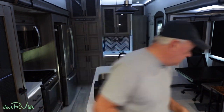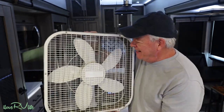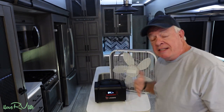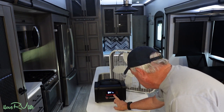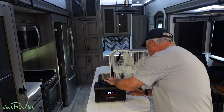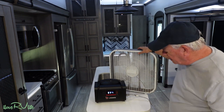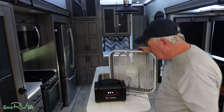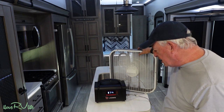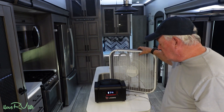Here's a standard AC box fan — the kind you find at any big box store. I'm turning the DC power off and switching to AC. On the lowest setting it's using about 41 watts and will run for about nine hours. On medium it climbs to 44 to 51 watts. From a ball game perspective, games run about an hour and a half to two hours — you'll get two or three games in, and this unit would hold up the whole time while also charging phones.